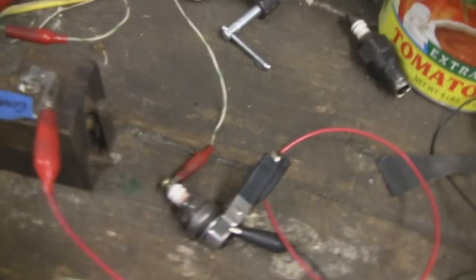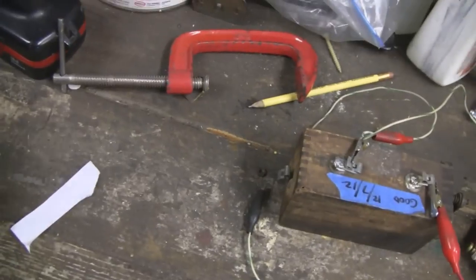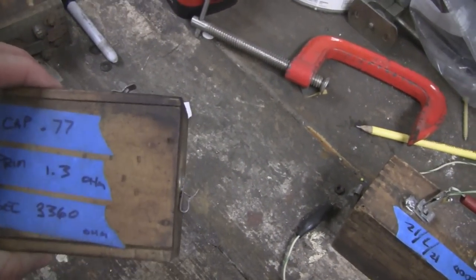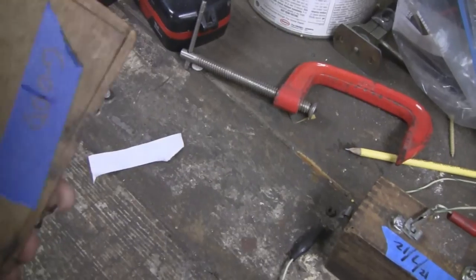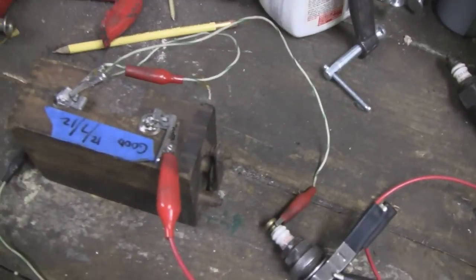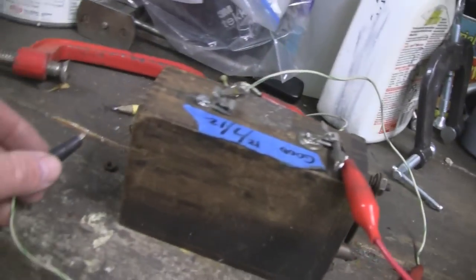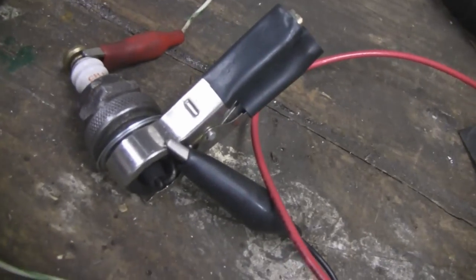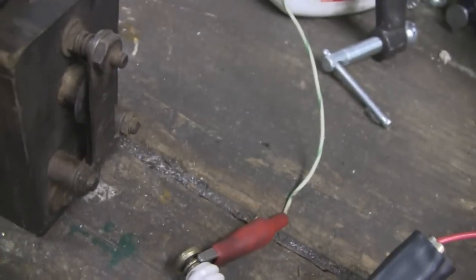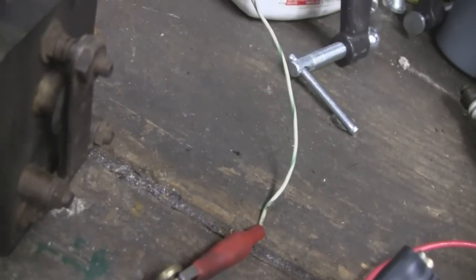I got this one hooked up. What I usually do with my buzz coils is check them all out — check the primaries. Here's one: the capacitor was .77, the primaries were good, secondaries were good. This one here is good and let me show you what the spark looks like. I got it hooked up to a little 6-volt battery. You see the spark down here on the spark plug. That's what you get; sometimes you get a little spark out of the contacts too.